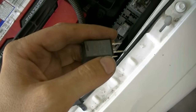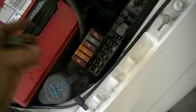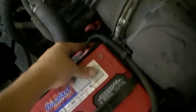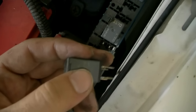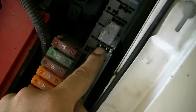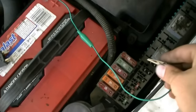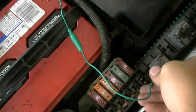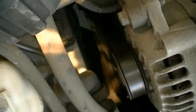I'm going to do that now using any kind of wire. You just want to connect the positive side of your battery — which in our case is conveniently located next to the fuse box — and run a wire from the positive terminal to the socket where terminal 87 would go. With the car running and the fan on the highest position, I'll use some alligator clips to connect the positive side to that terminal. Then we go over to the compressor and check — and as you can see, the clutch has engaged and we're ready to add Freon.